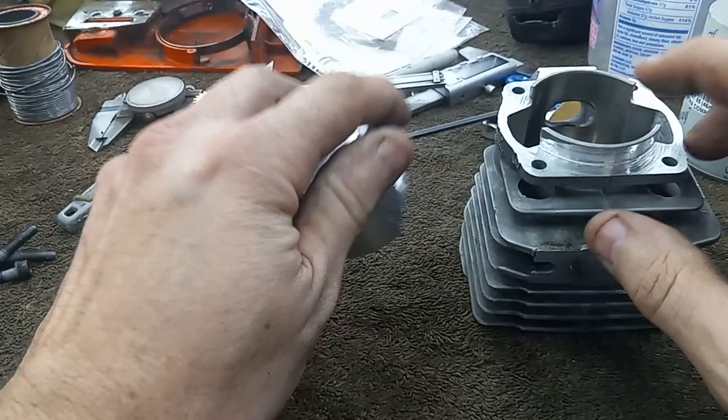There's the final shape I went with on the intake. I ended up getting this after JB Welding in here and doing all the machine work. I've got this set at 77. Exhaust is 105. I was able to drop it down low enough to get 105 after cleaning it up and straightening out the port. I fixed this gasket surface the best I could — I think a gasket will seal on it.